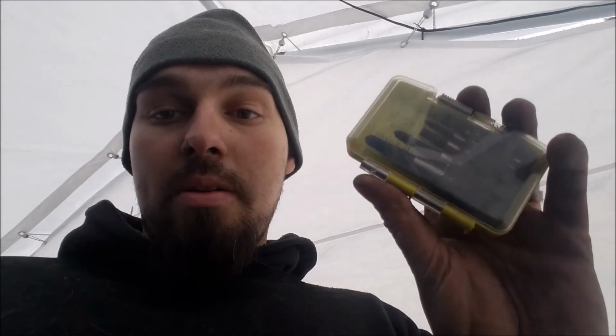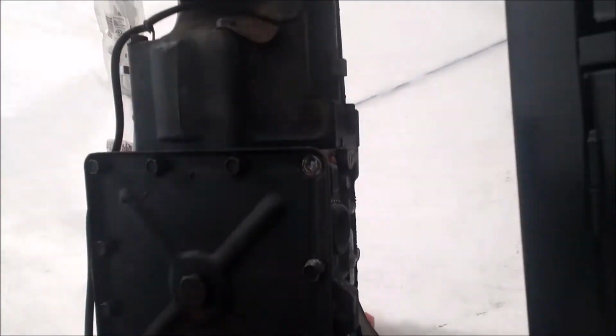Even though I used it when I had to pull two exhaust manifolds, and they came out. So yeah, don't use these, I guess. Or I guess try them, it's worth a try. But yeah, we just drilled it out, as you just watched. Drilled it out, and then we'll have to retap it. So, alright, that'll be it for this one. No, I'm just kidding. All right, real quick, we tapped it to M10 by 1.0, so I don't forget. This is a reminder.